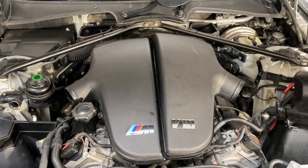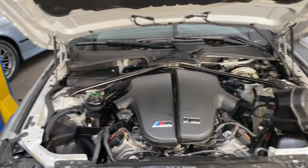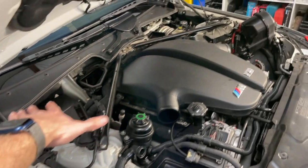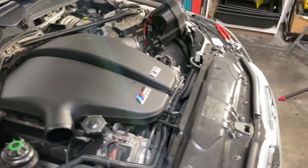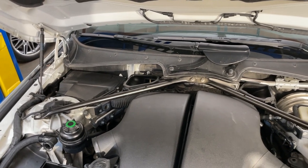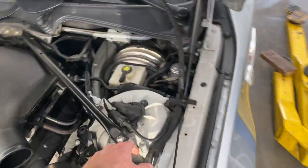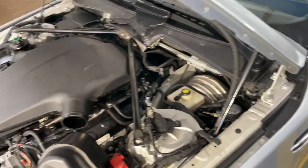Today we're doing the teardown. Everything up to this point my partner has done, and I've filmed before. If you can't get to this point — having the upper air boxes off, the cabin boxes and cowling removed — you probably shouldn't attempt to work too far into the valley of the S85. You'll need a series of flathead screwdrivers, 10mm and 13mm sockets, and Torx 20 bolts for the cabin boxes at the strut tower.